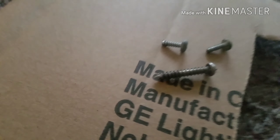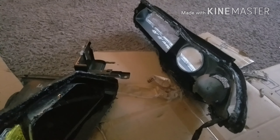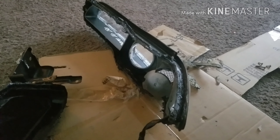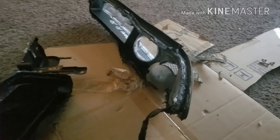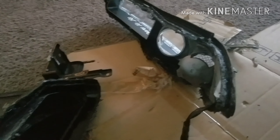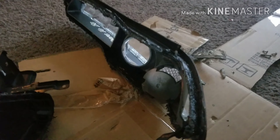After you get those screws out, you can heat up and pry off the actual lens. If you don't take those screws out and just heat it up and try to pry it off, it's not going to come off. Definitely take your time — don't heat it up rapidly all at once because you'll end up burning the actual lens glass, and that's not replaceable unless you get new headlights, which will be like $700. So take your time, heat it up, pry a little bit, make sure you got all the screws out.